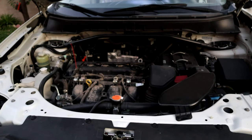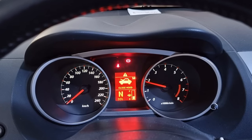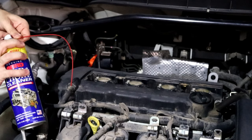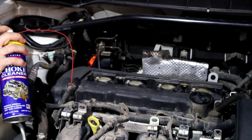Now we are ready for the cleaning process. Let's turn the engine on and let it reach idling temperature. The engine is warm at idling temperature — I'm going to use my foot on the gas pedal to hold the RPM at 2000. Now we can attach the carb cleaner and spray it like that. You can use half a can and you'll get a good result, or you can use a whole can for better cleaning.